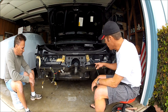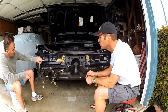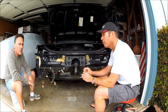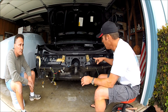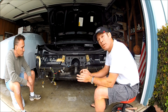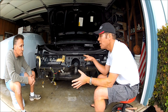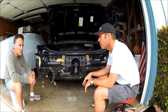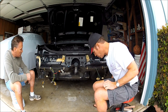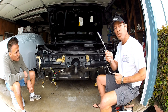Now a couple things to point out. These studs are what the bumper filler mounts to — you've got about a dozen of them from the factory. They're pointing in all different directions. The tolerances on this car vary — some are good, some aren't. When I drilled my fillers I put the holes where the average of the studs are, so when you put the filler on all holes may not line up perfectly but they should be close.